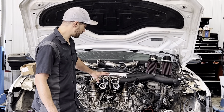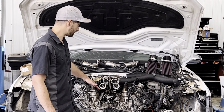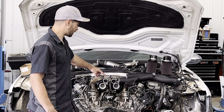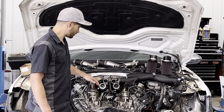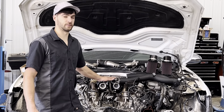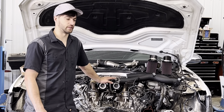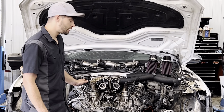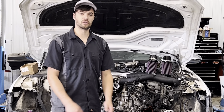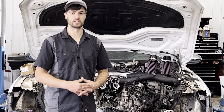Depending on the orientation of your turbos, if you do run into install issues with alignment, the turbo housing may actually need to be turned just a little bit so the pipe lays right. It's fairly rare, but if you do have fitment issues, a lot of times that will fix the issue if they are misaligned side to side.